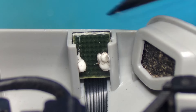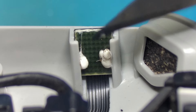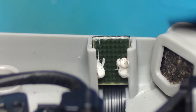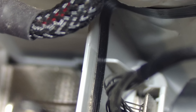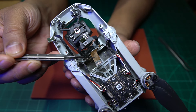There's some kind of sensor on the side which also comes off that same cable, and we have to remove this to be able to remove the entire cable. I'm going to use a little craft knife and attempt to remove this gently - this one's not too strong, so it should just come out. We'll do the same on the other side, and we should now be able to pull this out from the bottom. I think this cable is attached with some kind of glue, so if we apply some very light heat along the back, that whole piece should come out.